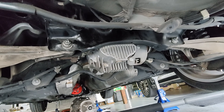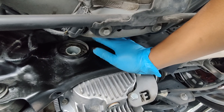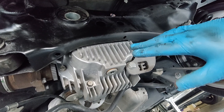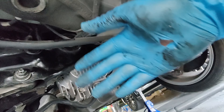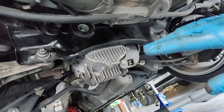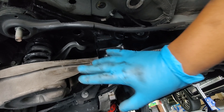This is my differential. All the way at the top there's a tube that runs into a breather that goes into this arm right here. When the oil in the differential heats up, as you guys know, oil expands — that's what the breather's for. When it's hot and expanded it needs somewhere to go. I was racing that hellcat, we went about 198 miles an hour, and the oil started coming out of the breather and leaked all over the frame and onto the exhaust.